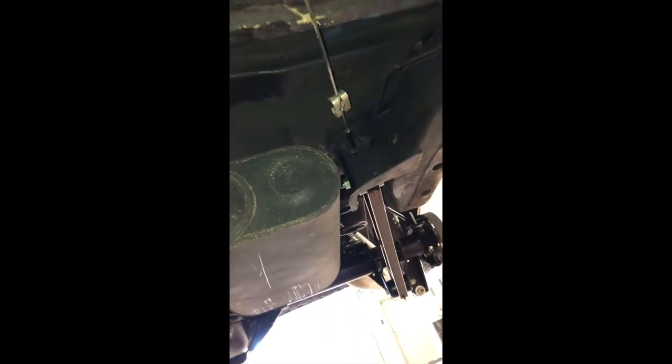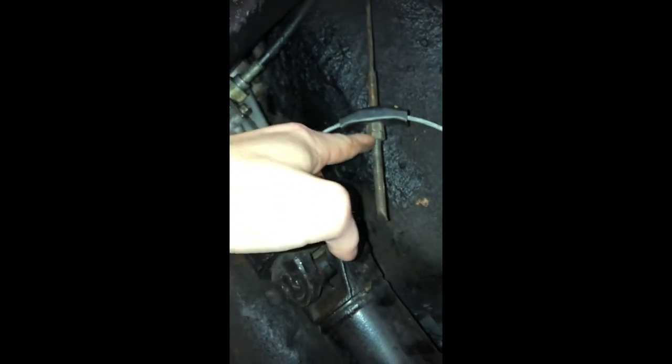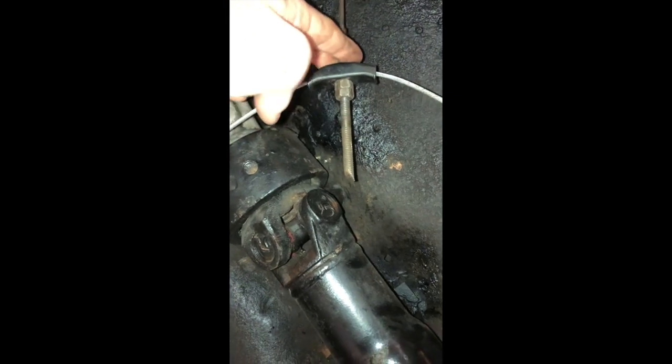The parking brake cables are in on both sides and it went fairly well once I had the right tools. If you have the same system, this is the adjuster you use to set the tension — I tightened the screws and used a lock screw to make sure it doesn't back off. I basically used the full thread length, though I'd suggest making the cable a little shorter so you have more adjustment room. Overall I'm happy with it — for what I needed, it did the job.